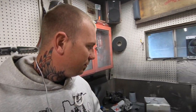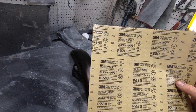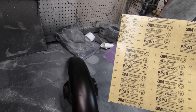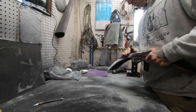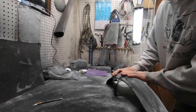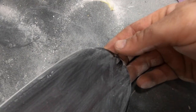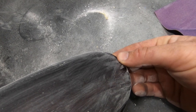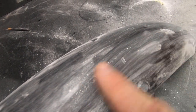Here I am in my paint shop, going to be painting this fender and making it a flake purple flake. To get started, I'm going to sand this fender down with 220 grit so I can put on my primer. If you have any orange peel on the paint, try to sand that down. You can see right here I have some orange peel — I'll sand that down flat so when I put my primer on it gets rid of that orange peel and any spots like this, so you won't see that through the primer.